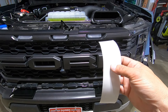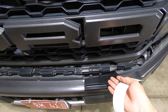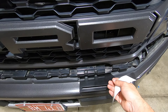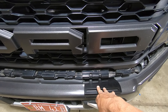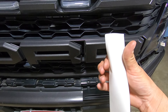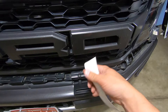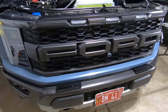Before putting that bumper filler piece in, go in the kit and find the helicopter tape — this is like a little vinyl piece of adhesive. When you're reinstalling the bumper filler, part of it is going to be over this bracket. Take a small strip and line the bottom edge of that bumper filler piece so that in the event it does come in contact with this bracket it's not going to damage the paint. It shouldn't, because we pushed this down as far as possible, but this is just an extra precaution. Cut it in half and put it on the bottom edge of that bumper filler piece.